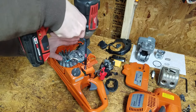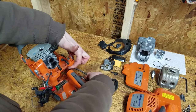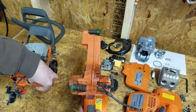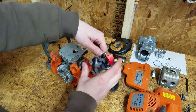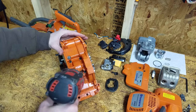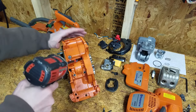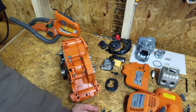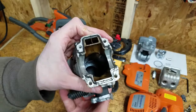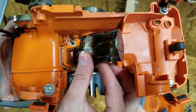To gain access to the screws securing the cylinder, I need to finish removing the fuel tank. With the third tank screw removed, I can pull the fuel lines through the holes and set the tank aside. Hold the flywheel down while pulling up on the cylinder. I don't see any scoring, but the piston ring is stuck fully compressed into the groove.